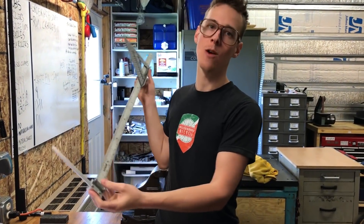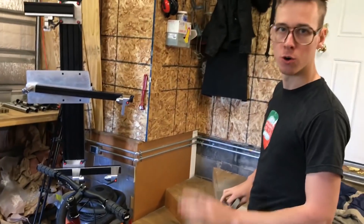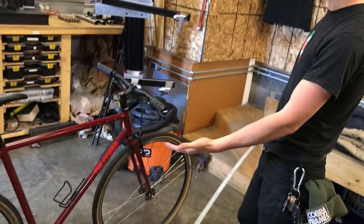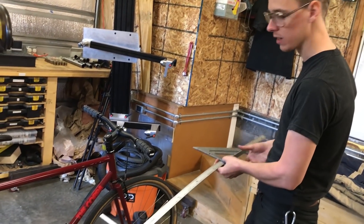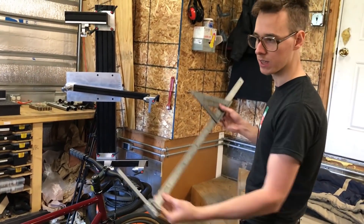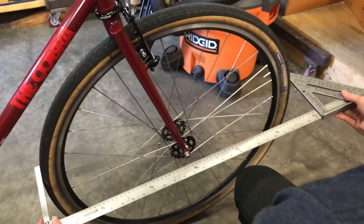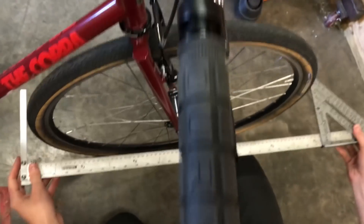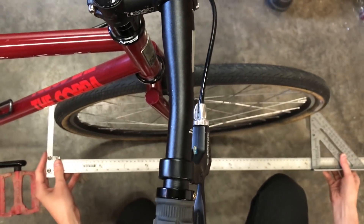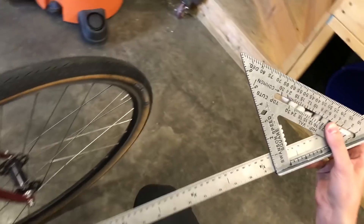I love my DIY yardstick calipers — here's how I'm going to use them. I need to know the wheel's true diameter because that affects the bottom bracket drop and a lot of other calculations, and that's a hard thing to measure unless you have something like this. I want the calipers in plane with the wheel — not crooked — and I sweep them until I find the high spot. We read 702 millimeters.